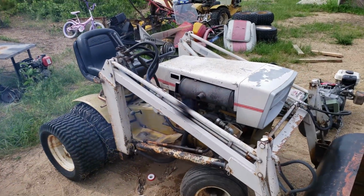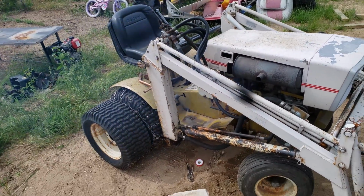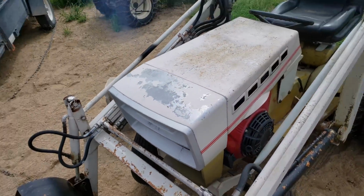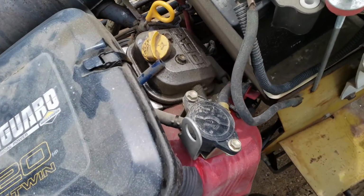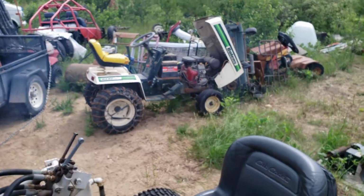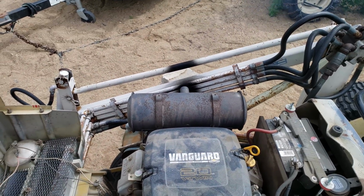Sears hasn't ran in a few weeks, and I just got it going. There was a lot of gas in the oil. It's running on only the front cylinder right now. The back cylinder is dead. But because I can't get in there to get that spark plug out, I had to pull one spark plug from that engine there, switch it to the front one, but I'm just getting it hot, and then I got to drain some oil.